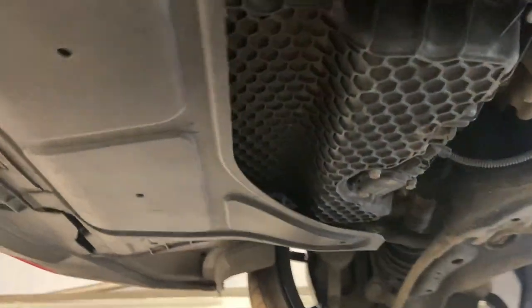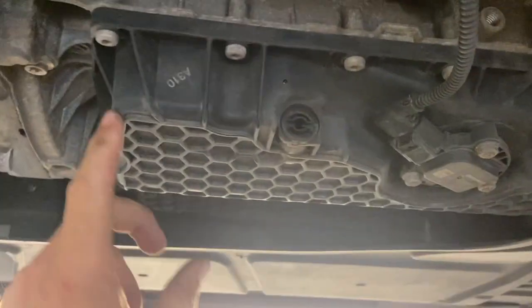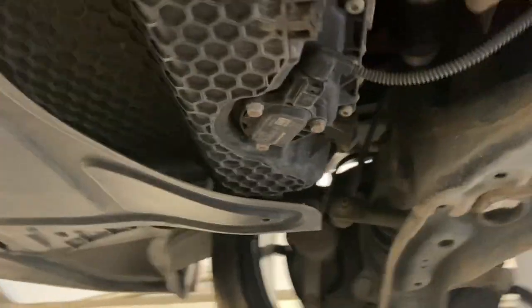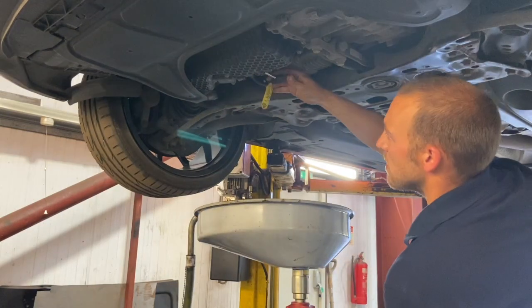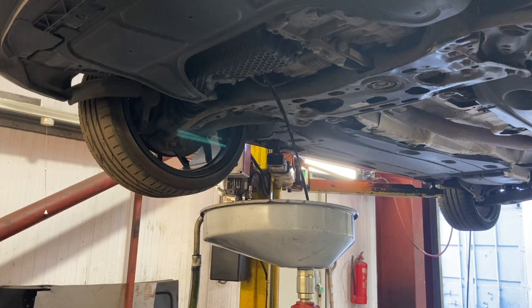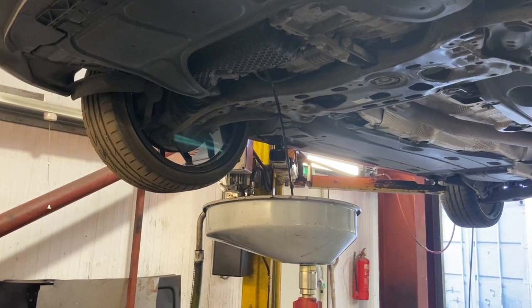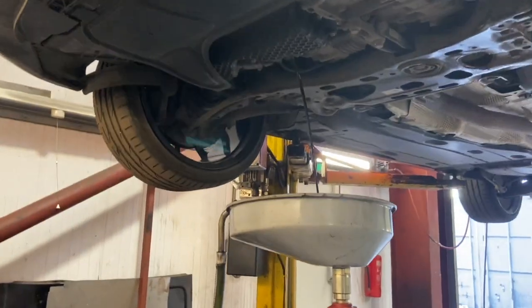Now that we've got it up in the air, we've got the sump — it's a plastic sump on these and the sump plug is just a little plastic plug. We're going to put the key in and crack that off, turn that out, and then drop the oil. We've got the old sump plug out — we'll do away with that. We've got the engine quite warm before dropping the oil, and we're just going to leave it draining for five minutes to make sure it all comes out.